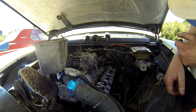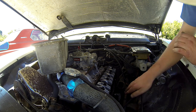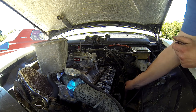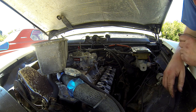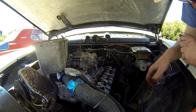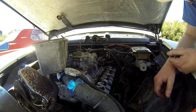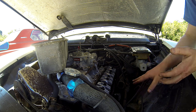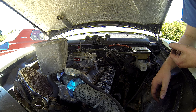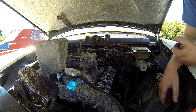A lot of memories coming back. The steering knuckle here hits the manifold too, and I think when the car bottoms out, the manifold is hitting the part of the frame there, and that's what busted this. That's what led to the whole experiment. I was going to try and get the whole manifold off and replace it with a new one, and maybe bang the wherever it's hitting. But that hasn't happened yet, of course.